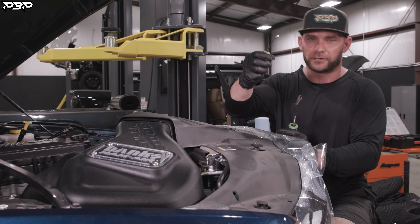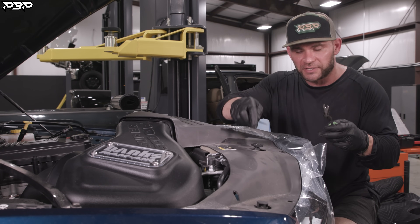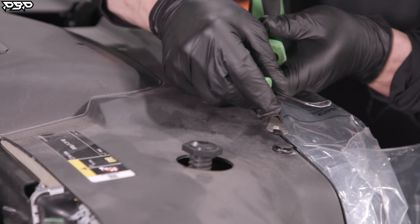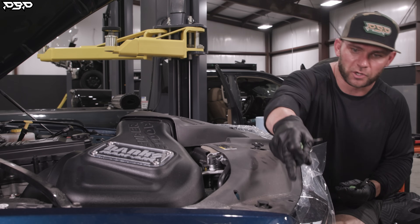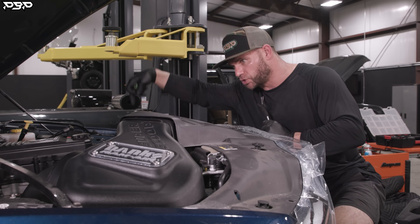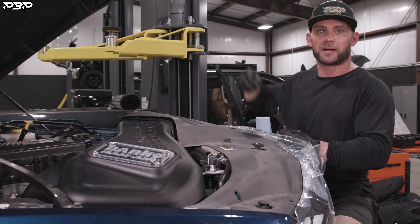The two tools I'm using are a little spoon tool and a panel popper — that way you don't ruin these old guys. Take the little spoon tool, put it up underneath that rivet, and pull it straight out. Go along all the way around the plastic valence piece; there are two at the back. Once you get all of them out, this piece just pops off.